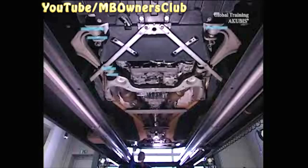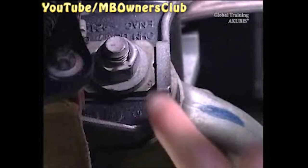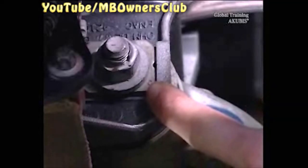You can find four adjustment plates on all of the mountings for the front and rear axles. The plates are numbered — write down the numbers. Two plates with the same number are mounted on every bolt, so you only need one number per bolt.